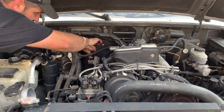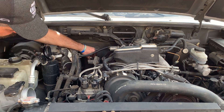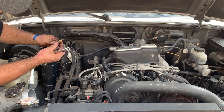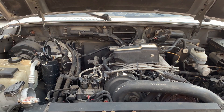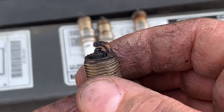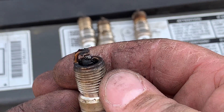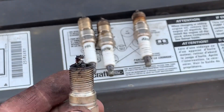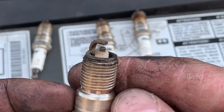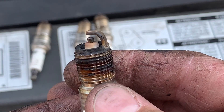At least they've kept all these brackets out of the way. I can actually pull all these plugs out without removing any more brackets. As you can tell, that plug there — she's got a lot of oil on there. Crazy looking. That's number one cylinder. That could be the dead one, because all the rest of these — number two, number three, number four — don't look bad.